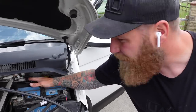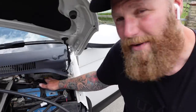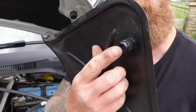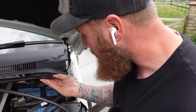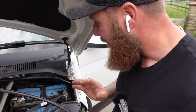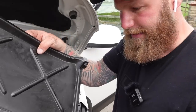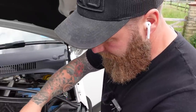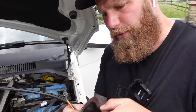Deep in the depths behind the battery there's a little plate — all you need to do is lift this panel up and that reveals two Torx screws. Remove that plate and you have access to the bulkhead. In that bulkhead already is a little pass-through with a grommet. I'm going to make use of that. This is the little panel I've removed — I've put a gland on there because this is actually fairly waterproof with a rubber seal, and it stops water hitting your bulkhead and rotting it out. So instead of just drilling a hole and negating its true purpose, I've used a gland. Installing that little switch with the on/off and mode, you would normally want that to pass through into your cab area — but not me.